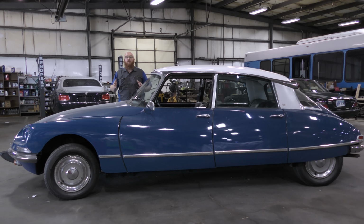And full brake force is only within 1/8 of an inch. It's not like the pedal goes way down or halfway to the floor. There's very little movement in the brake pedal to get drastic braking pressure. And it's because it is hydraulically boosted. It uses the hydraulic system that runs the suspension as the power to run the brakes. Rolls-Royce and Bentley of the 70s, 80s, 90s, they used this system on their cars. And their brakes feel the same way. It's very touchy, it's very strange.